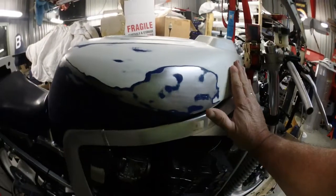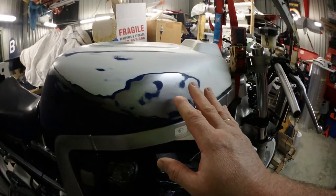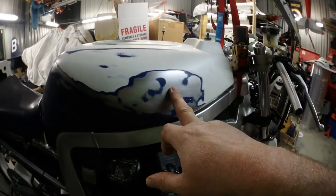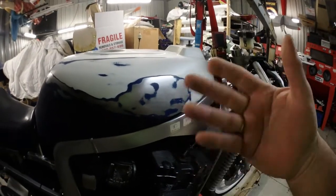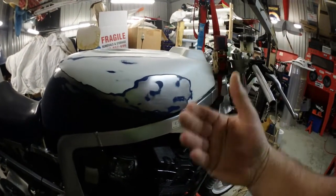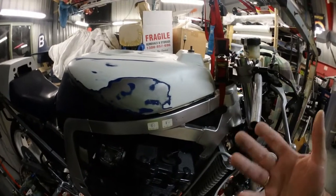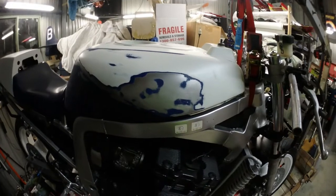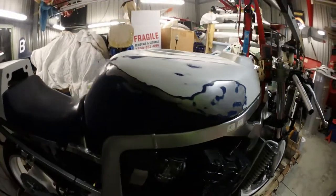This is where the stickers were, so they've actually come right off, because the stickers, for some reason I've noticed in the past, do sometimes penetrate all the way to the metal. And if you just rub them back and get the sticker off and then paint over the top, you can sometimes have stuff coming back at you, and it's the glue from the sticker, even though it's all those years old. So I always make sure I take them all the way back down, undercoat, primer or whatever you need to do, and get it back up again.